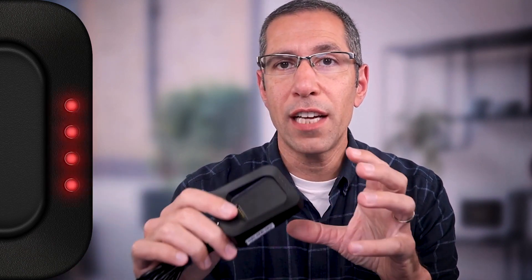If the lights are white-red-white-red in that pattern, then you know that the voltage is incorrect and you need to change the power brick being used. If all four lights are flashing from white to red and back, it's a temporary failure — the battery could be either too hot or too cold, but it is not a permanent malfunction. You just need to cool down or warm up the battery and try again. Finally, if you see all four lights are red and flashing, this is a permanent failure and it means the battery needs to be replaced.